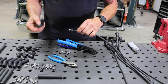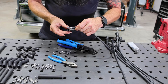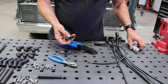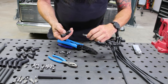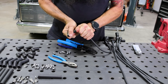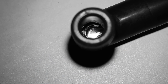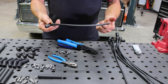We're going to put a little bit of dielectric grease on the boot and then push this in to make sure this part is lined up. The larger side is for the spark plug to go in, so we're going to push the wire into the small end with a little bit of dielectric grease — doesn't really matter what kind. Push it in and if you do that correctly you should see it lined up perfectly with the boot. If not, you can just rotate it a little bit. Now this is ready to put on the truck.